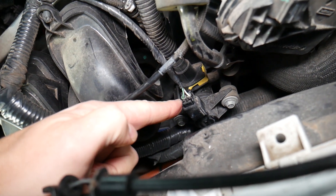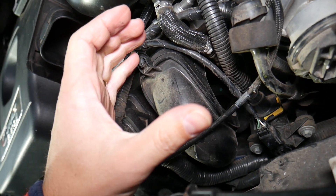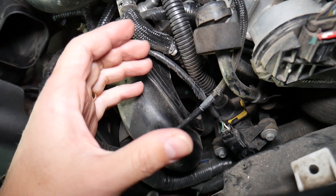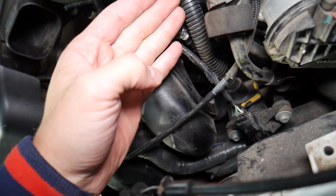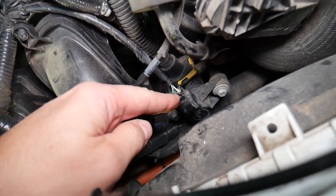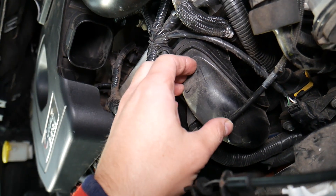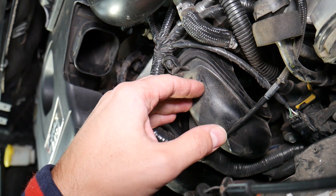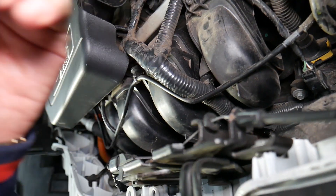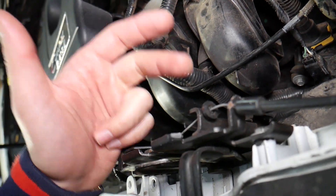What is a purge control valve? You have a special box by the fuel tank that catches the fuel vapors. When it reaches a certain amount of pressure in the fuel tank, that box will tell the engine computer to send them this way. The purge valve will open and they'll be injected directly into the intake manifold, where the fuel vapors will burn through the engine.